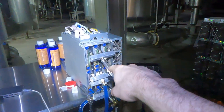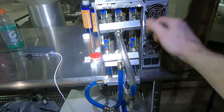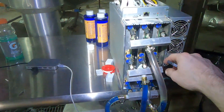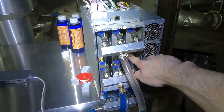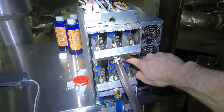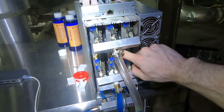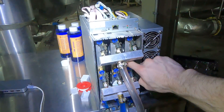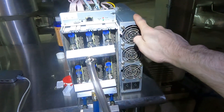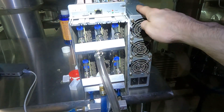Around 18, 19 — we've got the hydro-cooled machine here. This is an S19 Pro. This is the second machine I've actually set up. I've had some leaking issues and I don't know what's up with the hash boards. This is the second machine that I have basically put these water cooling blocks on. I will eventually pull these back out and go pull another machine with good hash boards and put the water cooling blocks on. I do have a 7,000 watt overclocking PSU that's not here, but I will eventually get that on.